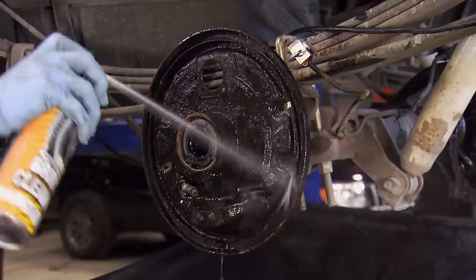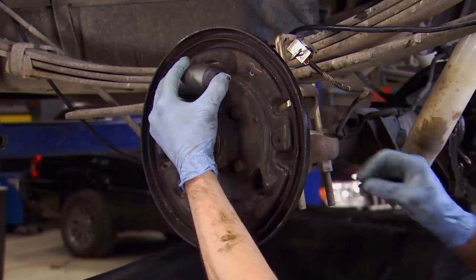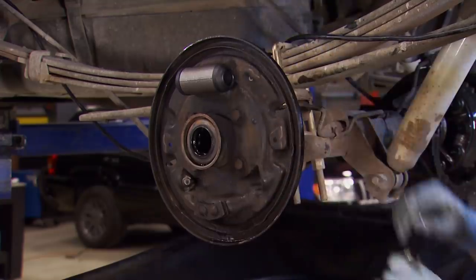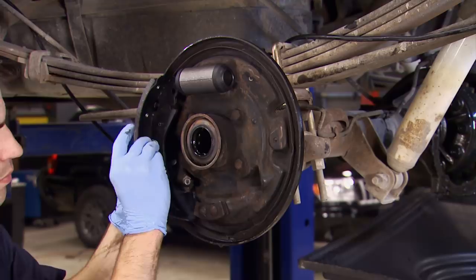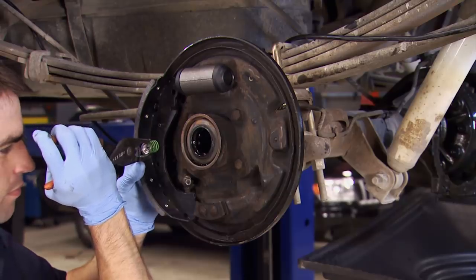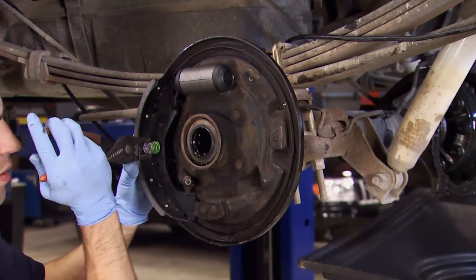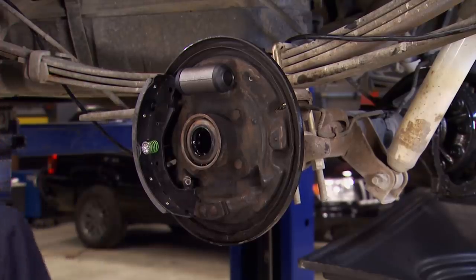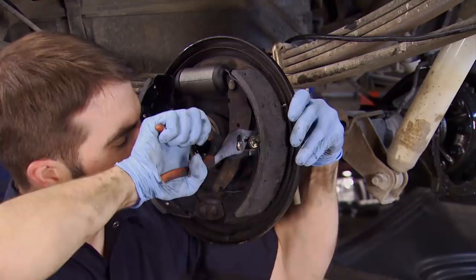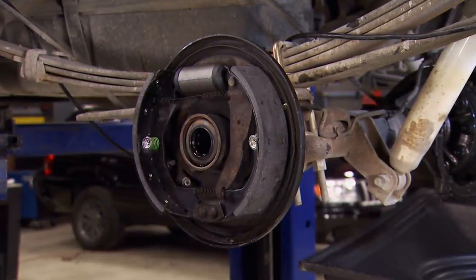A little bit of water neutralizes the brake fluid, and a little bit of brake clean washes everything down and dries quick so we have a clean dry surface to work with. The new wheel cylinder obviously fits right in place, retained by two bolts. Tighten them down, then attach your brake line. Reassembling the shoes is somewhat straightforward, but these little coil springs that keep the shoes pinned down to the backing plate can be a pain in the neck. They've got to be compressed a good bit and then rotated 90 degrees until the retainer clip seats. Then repeat the process on the other brake shoe, completing the installation with all the springs and small parts from the hardware kit, using the passenger side drum as a reference.